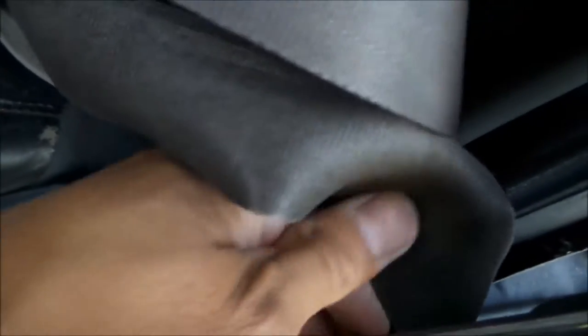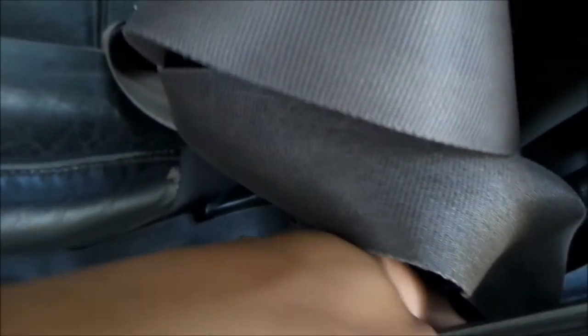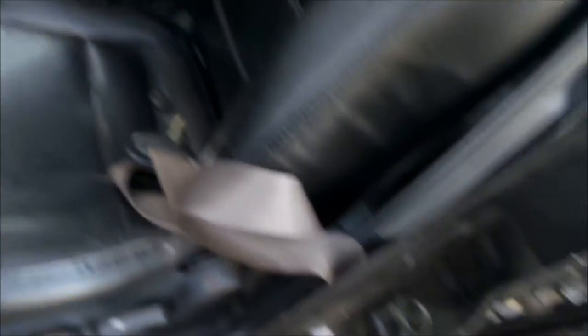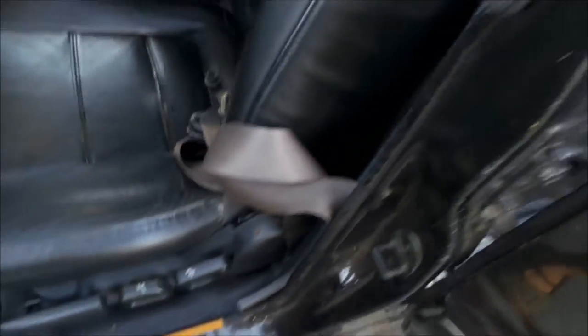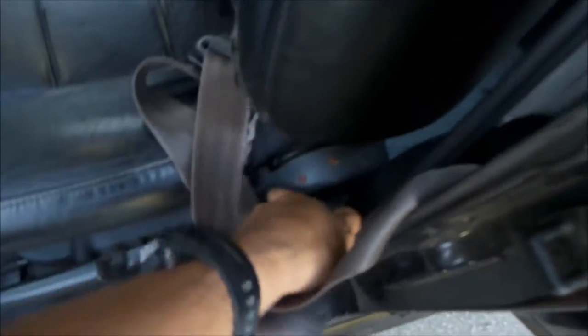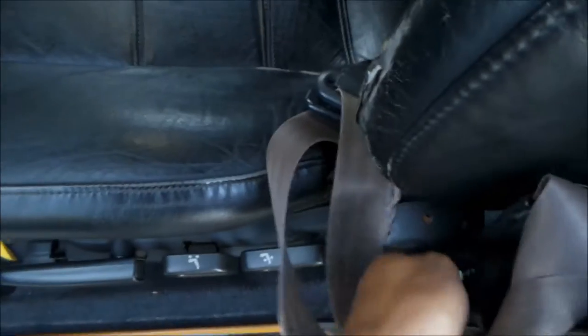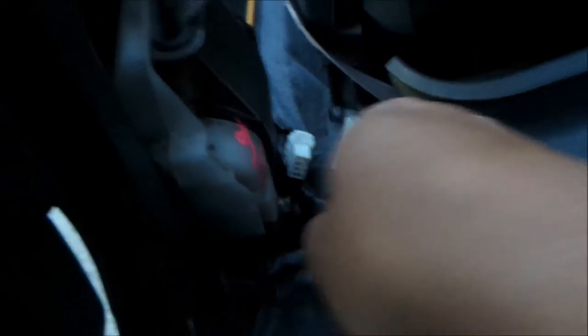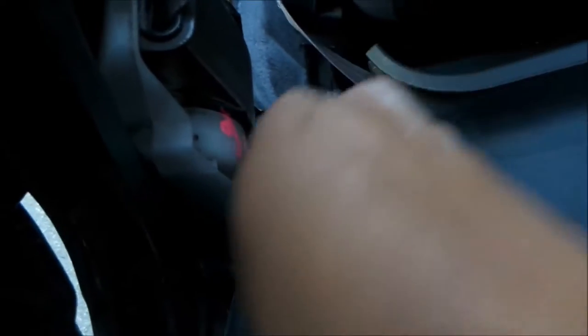It's also missing a screw. I remember there's a screw here - see this right here? There's no place to mount the screw. I could drill a hole, because it's one of those sheet metal screws. Why didn't they just drill a hole? I think that's what I'm going to wind up doing - drilling a hole in the car. Which is okay, because I like having a safe car to drive. I like to know my seatbelts will save me in an accident. Hiding under here are just two bolts. One there and one down yonder. I'm going to go ahead and unbolt those - kind of hard to get to. This one is to the retractor and the other one is to the other part of the belt, the end part of the belt. They're very hard to get to.